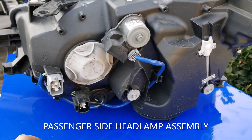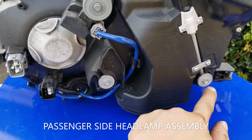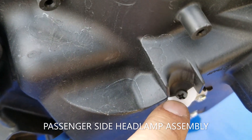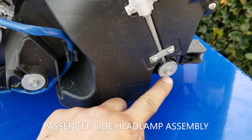For anybody that's interested in adjusting their headlamps, we have two adjustment knobs right here. This one is led all the way up here, which is controlled by a Phillips screwdriver. You can stick a Phillips right there and do some adjusting, which will turn this knob.